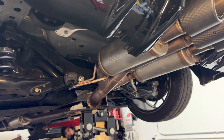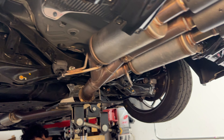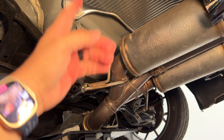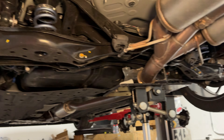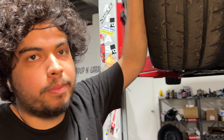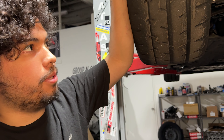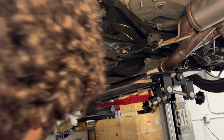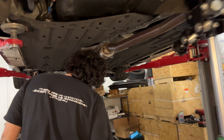Morris already started with the diffuser — he removed the plastic shroud here exposing the exhaust. He's already taken some of the hangers off, released it in the front, already disconnected the front pipe. Four of the rear exhaust hangers and then one of the midsection hangers.